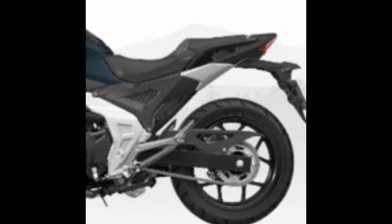is connected through a cable that runs through the bike. So from where the frunk is, where your traditional petrol tank would be, through the seats and under the bike into the back of the seat. And there is no way that I can see of easily accessing that cable and gaining access to the lock should that snap or foul or the lock fail. So I won't go into details, but there's a little video there about how I've tried to manage a workaround, a safeguard, should the key not work.